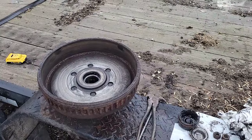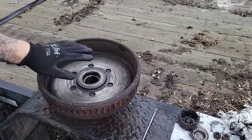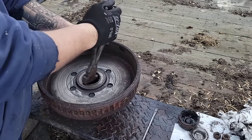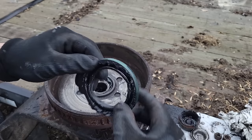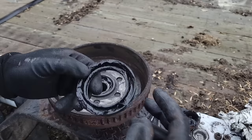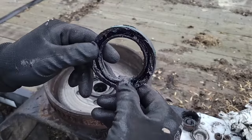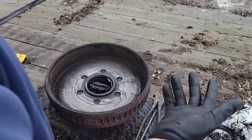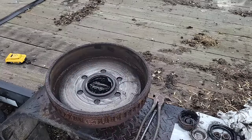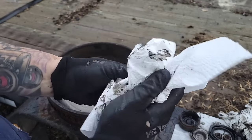Just to finish this off - this applies to all trailers regardless of axle size. They have an inner bearing, an outer bearing, and a seal. These seals all appear to be leaking - the magnet was covered in oil. When you're replacing bearings, you gotta replace the seal too. This is very similar to a crank seal. The spring was actually prolapsed - this spring, this seal is getting hard. It's not cracking yet but it's not pliable either. This is a job you want to wear gloves for because it is dirty.